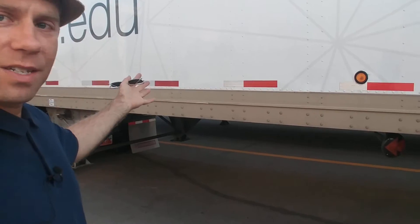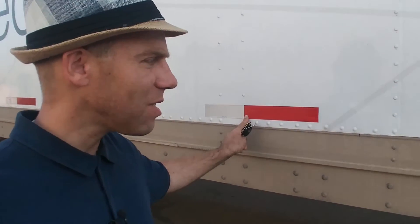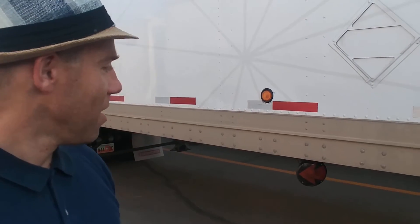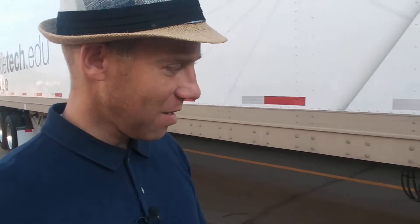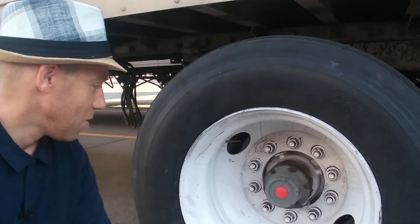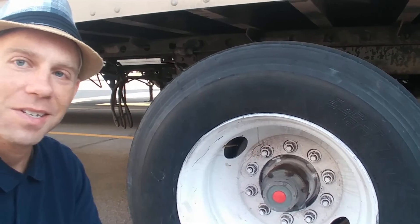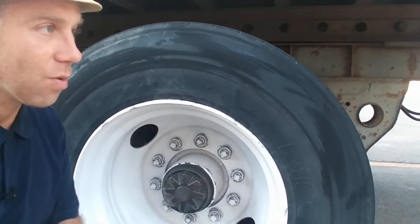Throughout the whole trailer — that's another part you've got to check off. In the booklet it calls these 'conspicuous tape,' but they're just reflector tape, so that's what we all call them. Make sure no rivets are missing and all that. You've got to make sure there's no leakage around the nuts — no rust streaks or oil leakage around the hub. Here's one where you can easily see how full it is — it's a see-through hub. That's a little bit of what I've been learning.